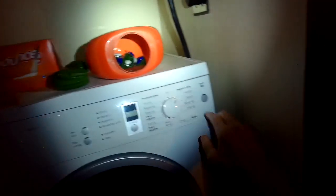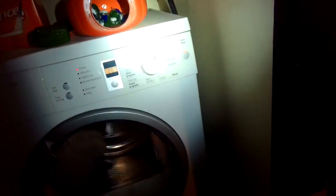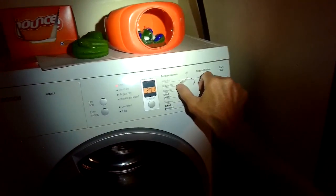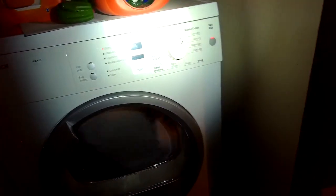I'm putting the drain tube back into the drain in the wall and going to finish up the cycle — just putting everything back together. This machine is fixed. With a little maintenance, these Bosch condensation dryers actually do a really good job. Just make sure you keep the filters really clean, keep the moisture sensor clean, and avoid using those dryer sheets. I hope this has been helpful to you and gets your machine going again. Thanks so much for watching, and please subscribe when you get a chance.